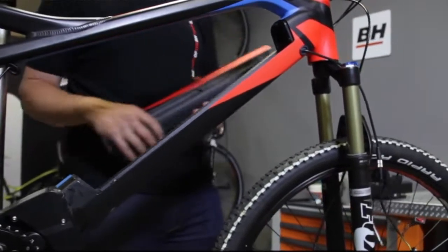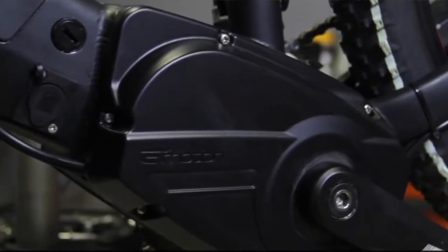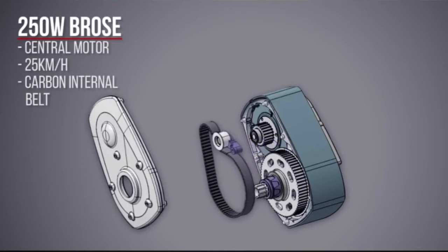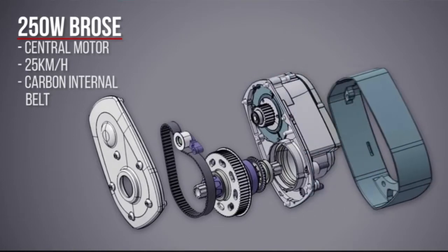In the past they've traditionally had a rear high-torque motor, but this time they've actually gone with a mid-drive motor, which is probably the most popular design of motor these days. They're using a Brose motor — you end up with very nice weight distribution, and it's an incredibly good hill climber and very efficient. Compared to a hub motor, it typically will get far more range on the battery than you would with a rear or front hub motor.